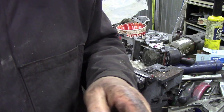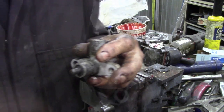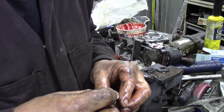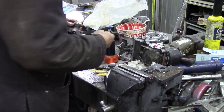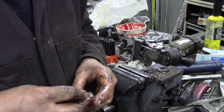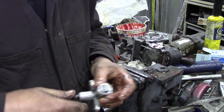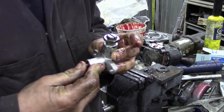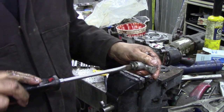So we're going to put it through the parts washer, clean it all up, grease it, and put it back together again. Take the little ball, clean it up, drop it in, push it in down there and put the cover back on. The idea is that the spring offers resistance to this plunger here. They did away with it on the 300 TDI.